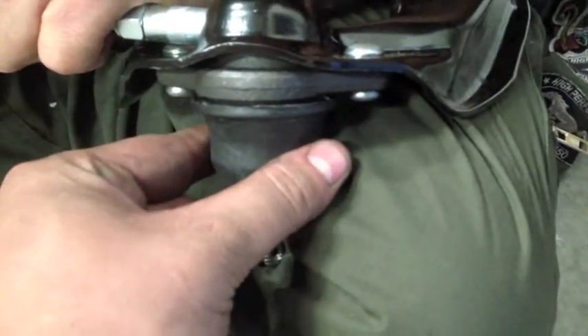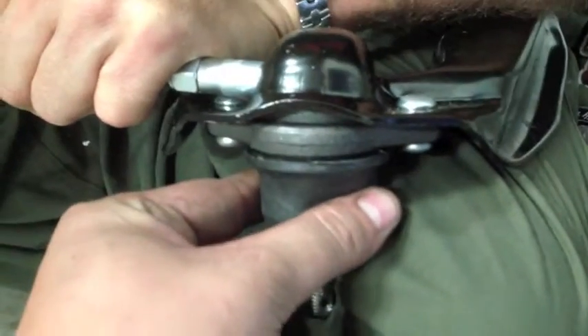It's actually just glossy right now because it hasn't dried yet. Seal your car up when you get the chance — all this area has now been completely sealed, nice and pretty and black. We are about to put the control arm in. Nick was able to get the second grease fitting facing forward. Let's grease it first and then we'll put it in. We're greasing up everything — see that, it's going to fill all the way up. There it goes — you can hear it, you can feel it.